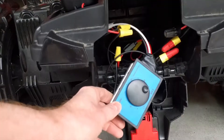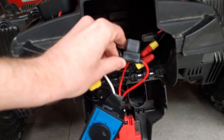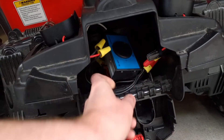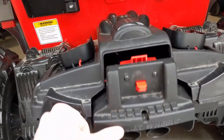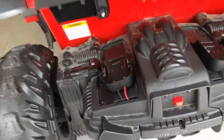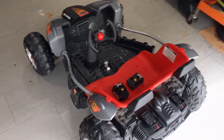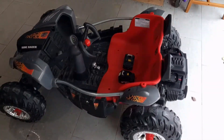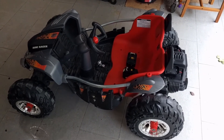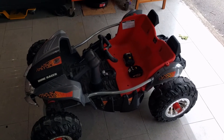I was able to get the speed controller and the fuses — just put like a 12 or 15 amp fuse in, since it's only going to draw about 11 amps. I didn't want to have too big of a fuse without it actually being effective. I've seen some people do 30 amps, but if it gets that high it could still burn or melt wire at 25 amps, so we wanted to avoid that whole mess.